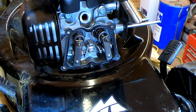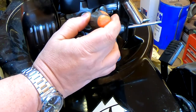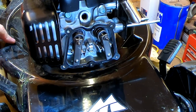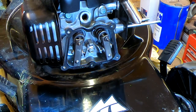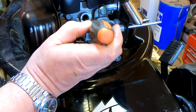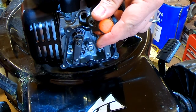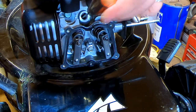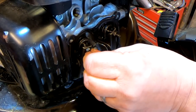It should pull over easy now — there we go. I'll stick a screwdriver in the plug hole and turn the engine over gently with the pull cord. As it comes down, the screwdriver comes up. When the piston is at the top with the valves rocking, that's the exhaust stroke — we need to come down and back up on the compression stroke. Now the screwdriver is just on the verge of going up and down but the valves aren't moving this time — that's when you can check the adjustment. I'm going to get the feeler gauges. I haven't looked up the specification yet for these, but on average valves are normally between 4 and 8 thou.